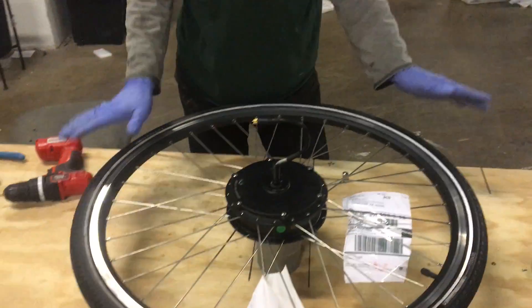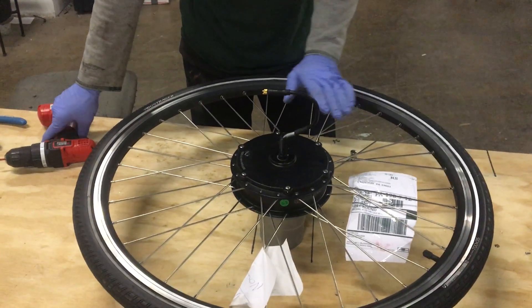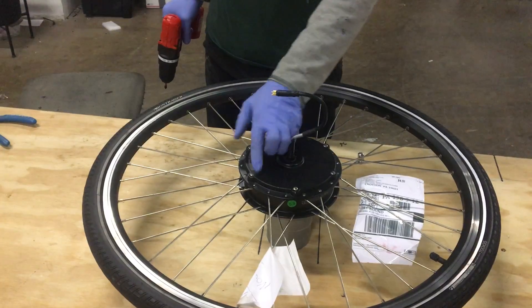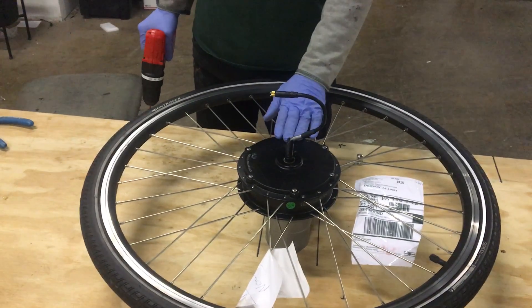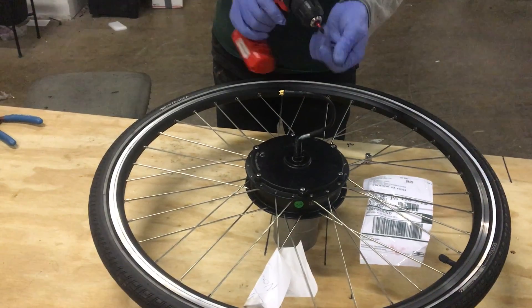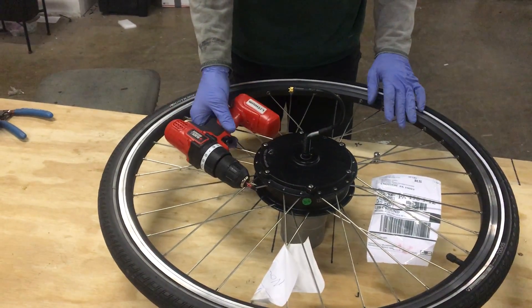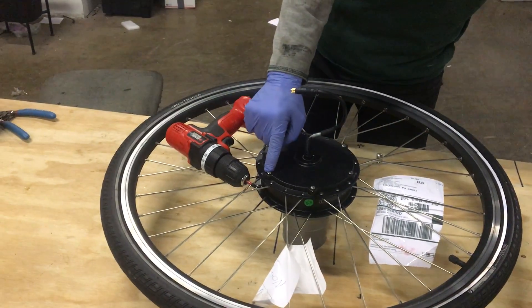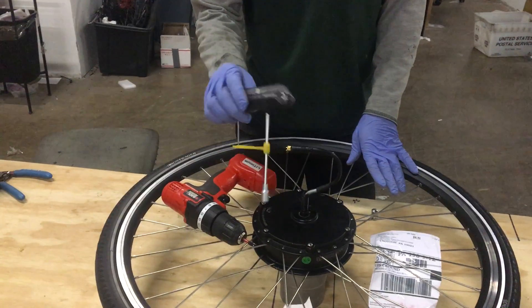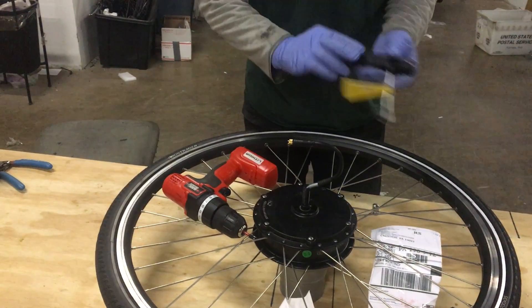Here's your old motor. Tire's still on. If it's a rear, the freewheel's still on. You've just taken it out of the bike. All you need to do is remove the six screws that run along the outside. These generally use a Phillips head drive — I'm using a PH2 screwdriver here. You want to make sure it's a good fit with the head of the screw so you don't strip it out. To avoid stripping the threads, I recommend using a torque wrench. About four newton meters is right for these screws.